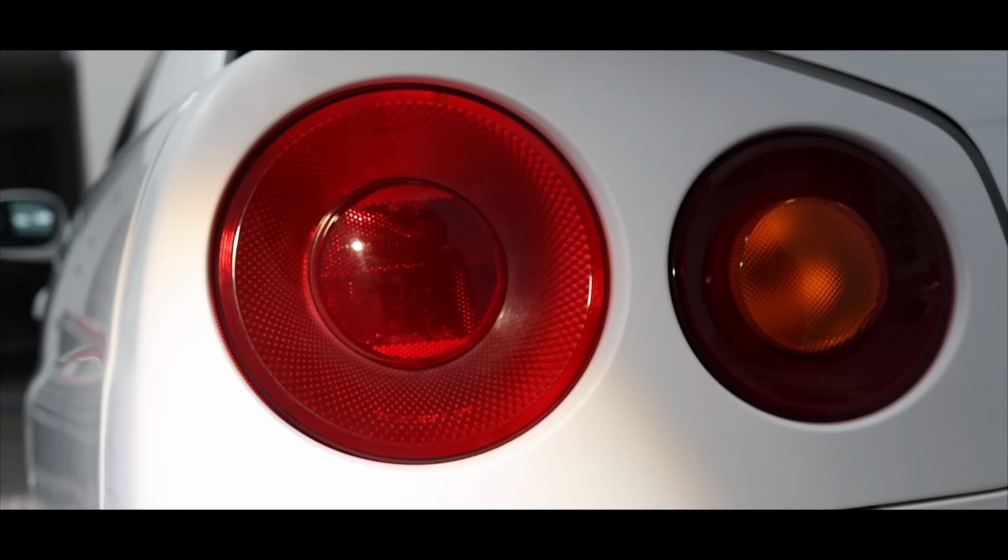With the paint and trims completely clean and bare, this is the time we can truly assess the vehicle's condition. Now, it's fair to say the paint has seen better days, being completely covered with swirls, as well as moderate and deeper scratches throughout. Apart from that, there's certainly a number of water etchings, dullness in the black and clear plastics, and a hazed and oxidized finish with a real lack of gloss and clarity. There's also some clear coat failure on the rear fender, some paint transfer marks, chips, holograms, and deeper staining of the paint and trims throughout.